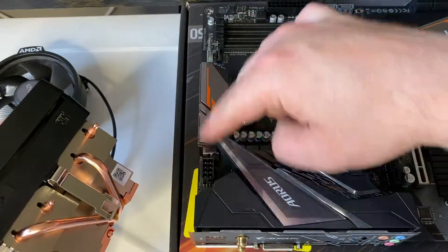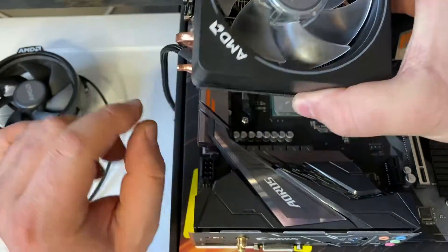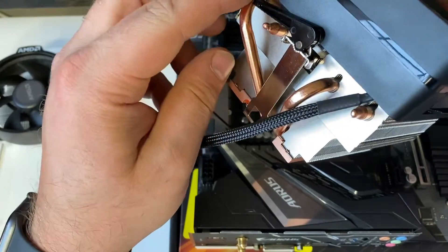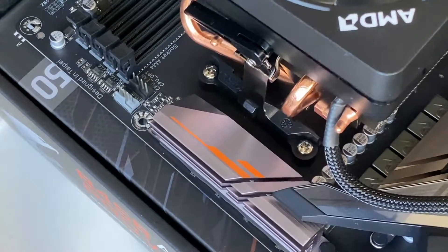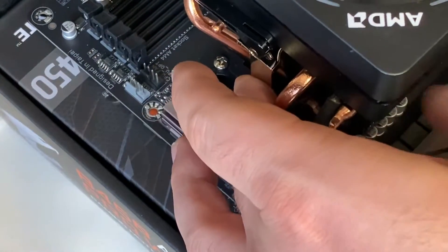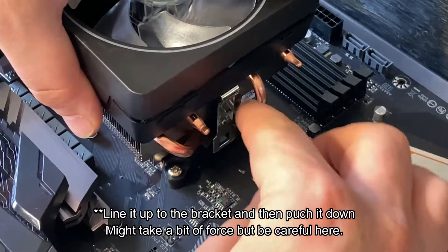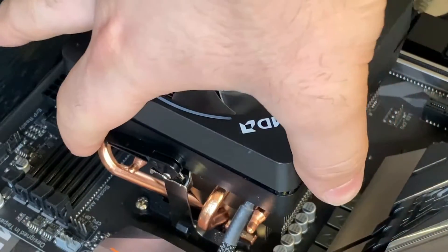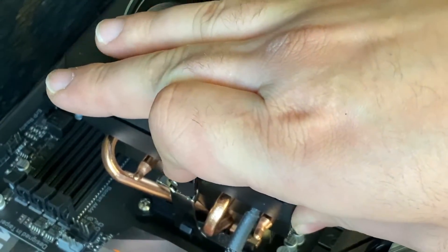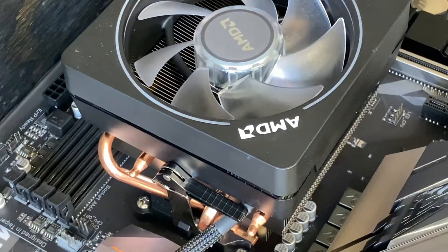This is the top of the board and that way is the bottom. I want the AMD symbol on my CPU cooler facing toward the top. With the lever down, connect the clip on this side first — you can see how it's connected. Then move to the other side, push it down, and the goal is to have it snap in just like that. Back on the side with the lever, you crank it down just like that. Now it's tight, snug, and it won't go anywhere.